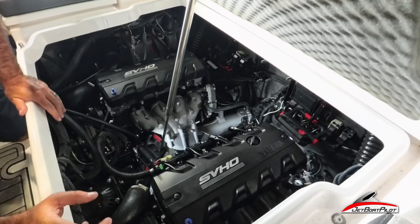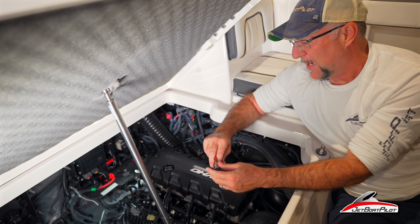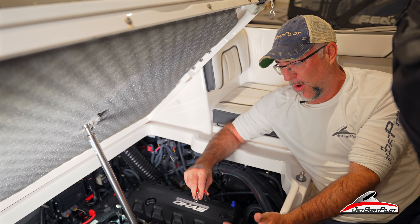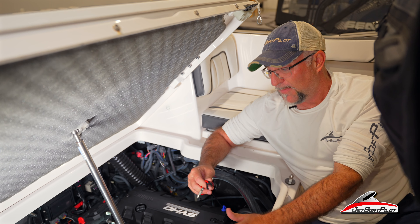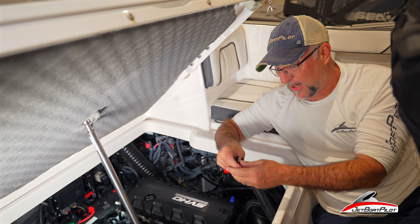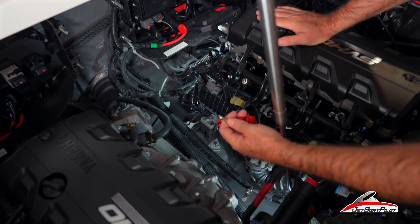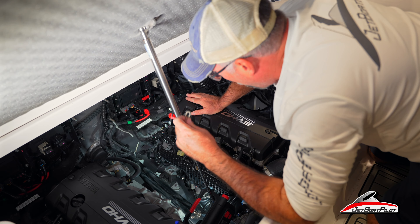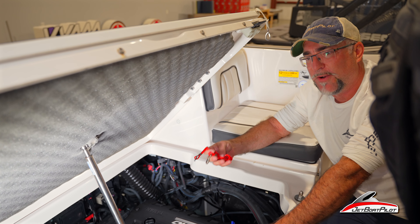This is the most important part of this whole process — if you don't listen to anything I'm saying, listen to this. It's possible to get this really, really badly wrong. If you take the boat, tow it home, get it fixed, go back out to the water, and go boating — but you forgot to take off those clamps — you're going to burn your motor up. In a situation where you're being towed home, it's best to take your lanyard, disconnect it from where you normally plug it in, and connect it somewhere down inside this area so that you cannot start your engine until you first retrieve your lanyard. Hopefully you're smart enough not to start the engine without removing the clamps, but whatever process you create for redundancy, it is important so that you do not start the engine without first removing the clamps.